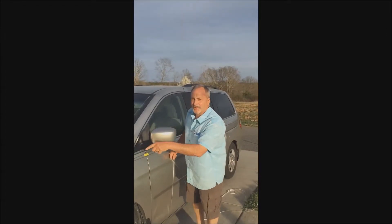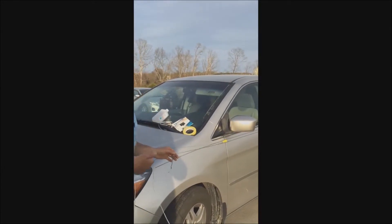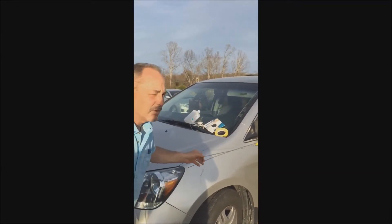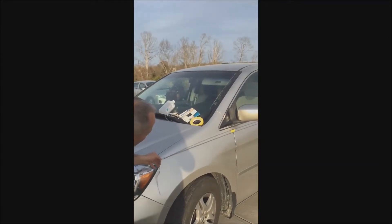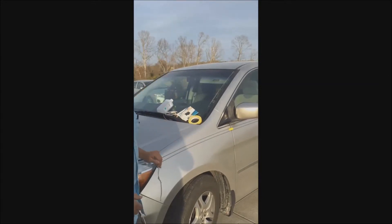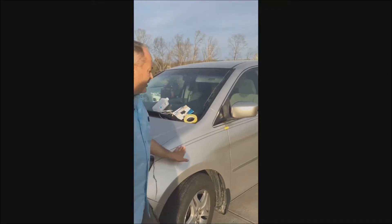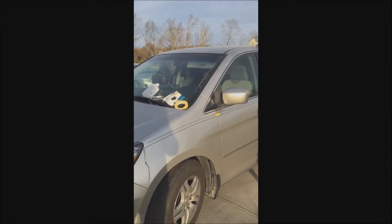What I'm going to do is come to the front of this panel and snap it up. Now on a real hot day you can't snap it up like that — it'll stick and go gummy. So you should do this in the cool part of the day. Then we just come down and follow a little bit of the curve of the fender and press it down.